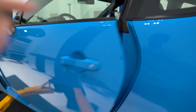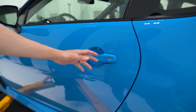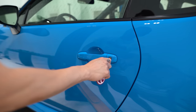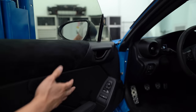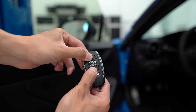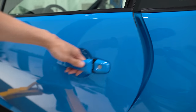Now we can toss the key fob inside the car, lock the doors, and as you'll see I can't unlock them using the handle. To get in you can use the PIN code entered in the trunk, another set of keys, or just the physical key taken out of the key fob. To re-enable the smart key function, do the same thing — open the driver's side door, press the lock forward, and press and hold the lock and trunk button on the key fob. Now when you lock the doors you can see the handles work again to unlock them.